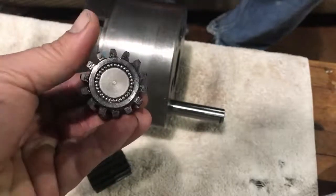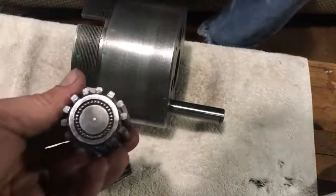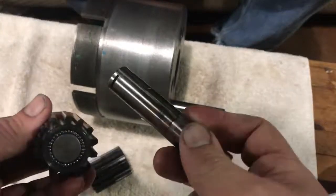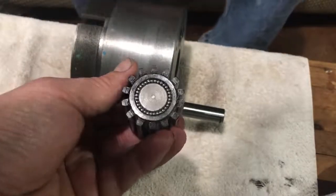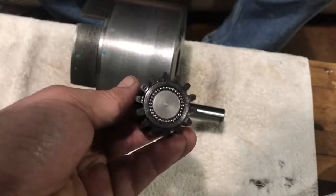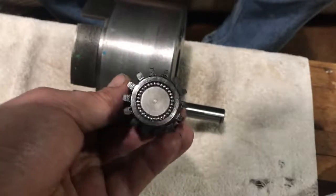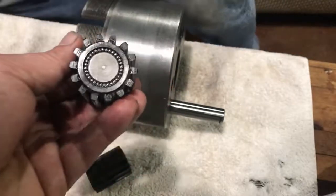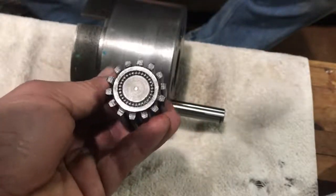There's a set of short gears that have an equal number, I believe. They're held in there by these shafts. The gear is held in there and the needle bearings are held in there as well. There's no race or anything that holds them in — it's simply the shaft. A tab holding those shafts in, if you look at the last video, broke. That shaft moved, allowing some of those needle bearings to spill out. From that point on everything just went haywire inside this transmission — metal shavings, broken bearings, started acting funny. It was a mess.